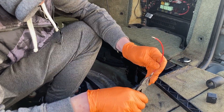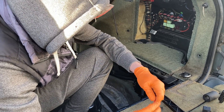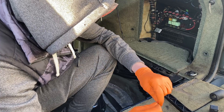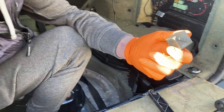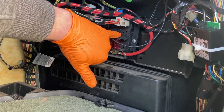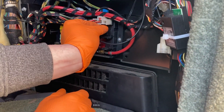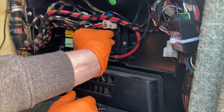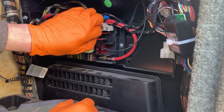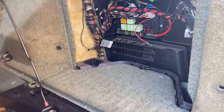I'll make this a bit more permanent later, but for trial and error it's good enough. I haven't got my wire connectors here so I'll work around that. I'm going to jump that relay — it's the top and the bottom contacts. I ideally need a spade connector but I haven't got one, so I'll push that in there and as you can hear, that's my compressor going. I just want to double check it's not leaking.